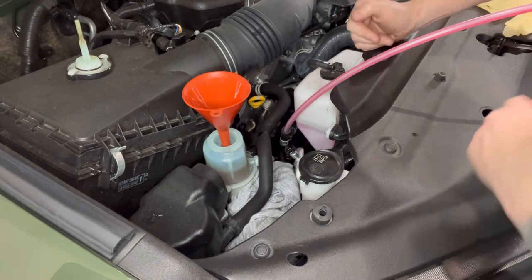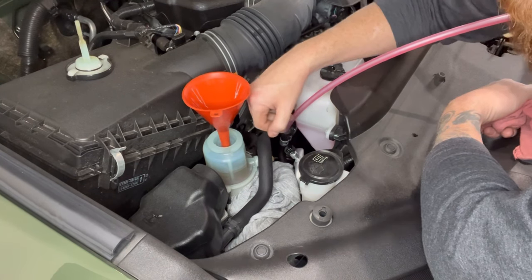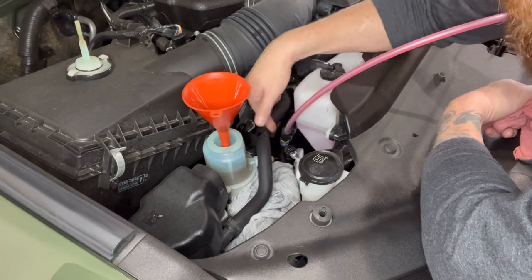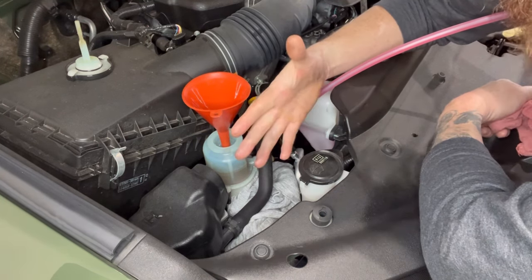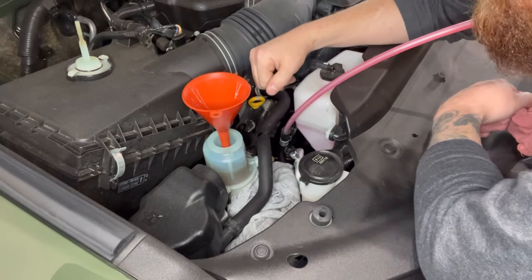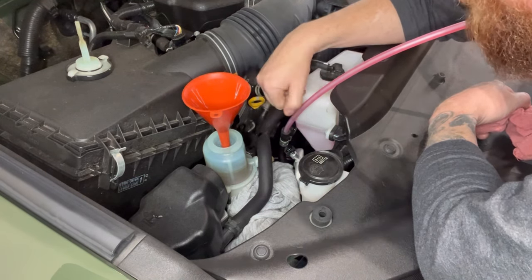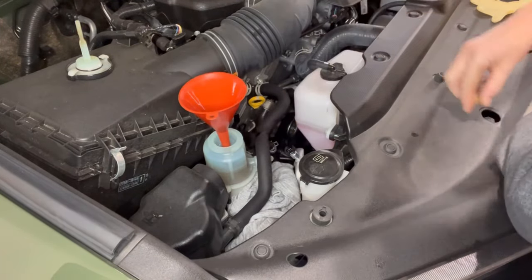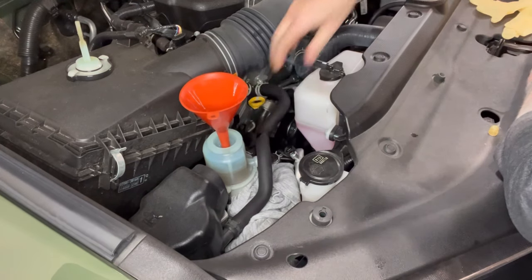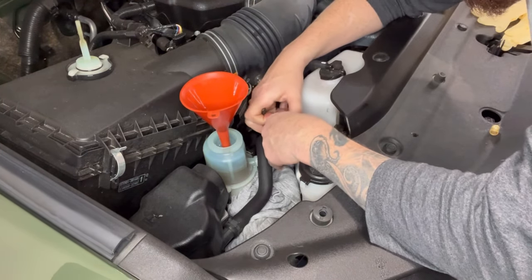Now there are two ways to go about the next step. First one: you leave this reservoir empty, take the plug out, and reconnect your hose. Or you can fill it up halfway, take the plug out, cover it with your finger, and insert the hose in there — obviously without spilling as much fluid as possible. What I am going to do is go ahead and leave it empty and connect my hose to the return outlet of the reservoir. Being that the reservoir is empty, you just take the plug out, reinstall the return hose, and then grab your pair of pliers and reinstall the clamp back in its original spot.